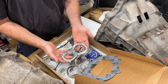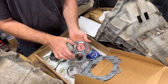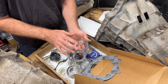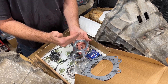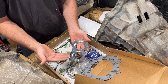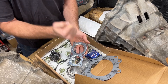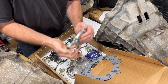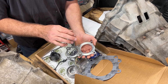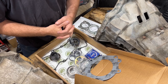This is a little bit different — this is a steel retaining plate for the countershaft and mainshaft. What this does is the aluminum will often wear out. On a lot of Ford Rangers you'll notice the shifter moves quite a bit back and forth and you get a growling noise. Usually what's happened is the aluminum retaining plate has worn out, especially when the countershaft is moving back and forth — it just pounds it out. So this is a machined steel one, and it was recommended to me by a guy who does a lot of desert racing. I'll post the part numbers in the description.